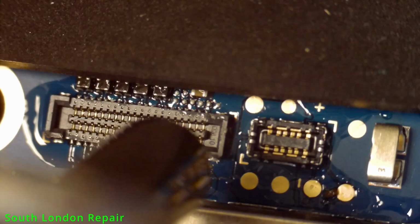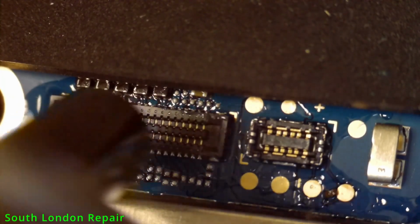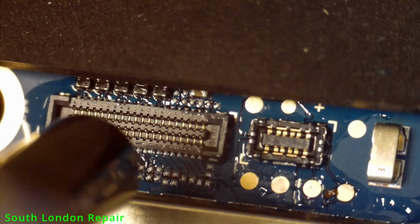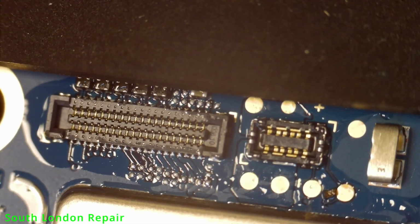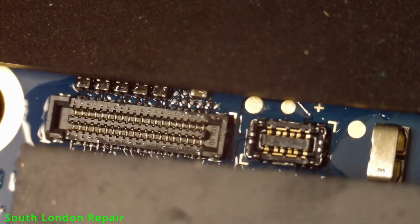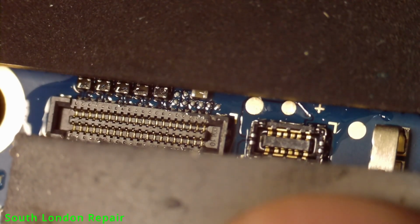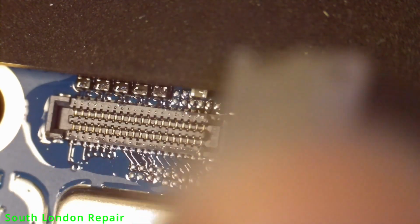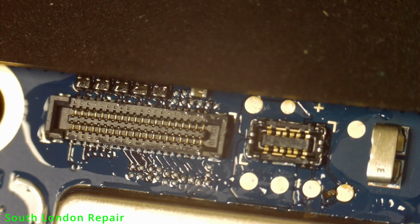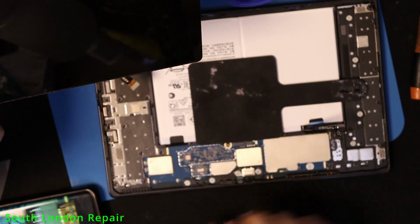It's like a standard FPC connection. You can find many videos about this. The flux will immediately get into the battery connector, but I'm not worried about that one, it's really easy to clean up. Under the microscope, you're just checking when it starts changing the color on the soldering point, and you know it's the right temperature. After I put down a cooling pad to take away the heat, but I didn't press against the plastic, because the plastic is really in a soft period at the time, so it's really easy to damage.